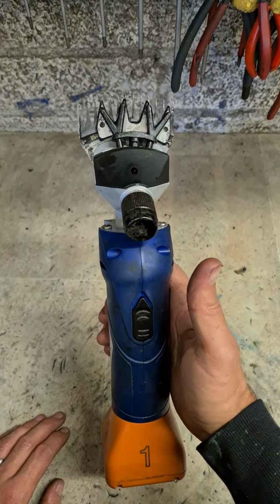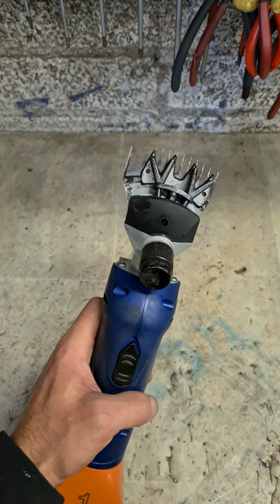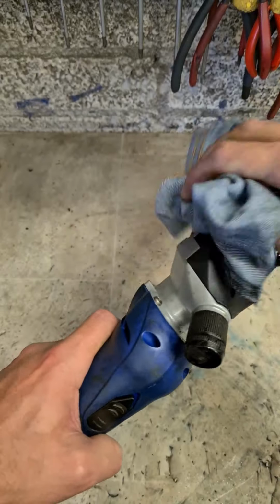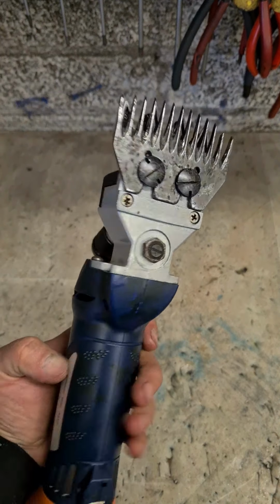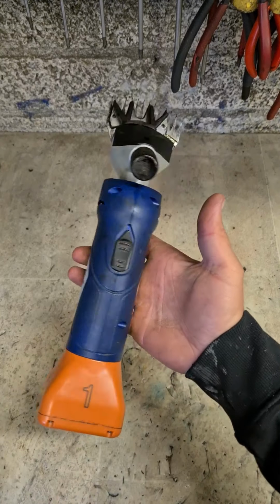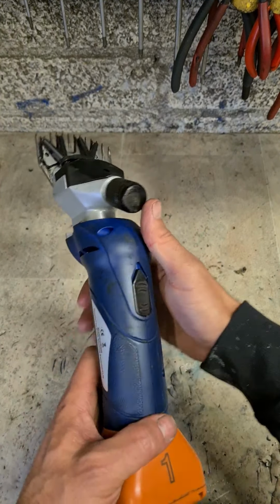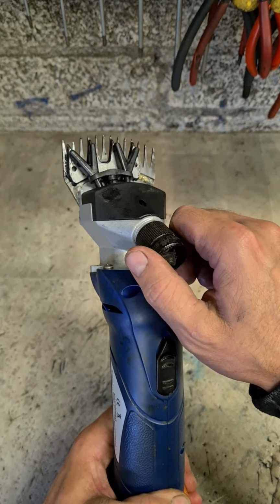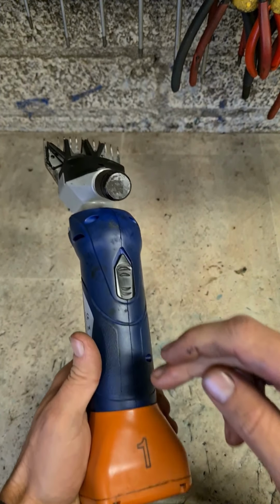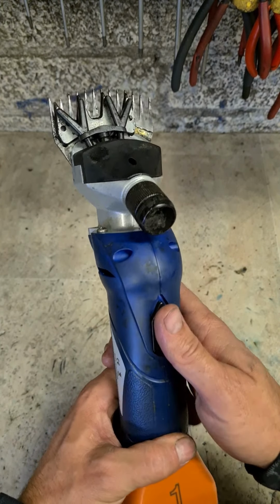That's her. One set of Welsh clippers up and running again. Just a wee bit of damage to the blades. A quick clean down and she's good to go. If they're using a set of shears and they're not switching on like that, you have to remember they're only a 12-volt battery. If you were tightening the actual cutting head, there's too much strain on the motor, too much draw, they won't actually start up, or they won't cut for very long.